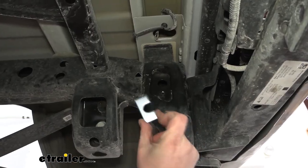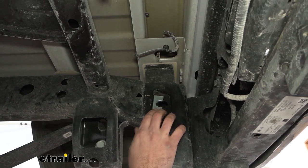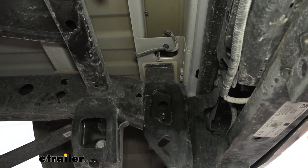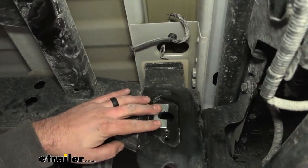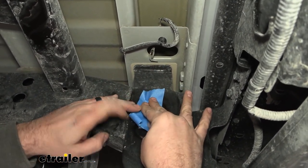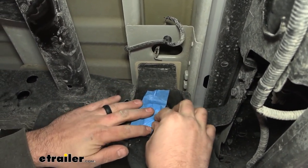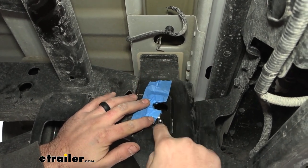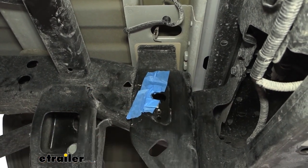On both sides of the vehicle, we're going to grab our U-shaped spacers, and these are going to fill up the gap that's in this inset. We'll need to make sure that we're not covering up the ground hole because eventually we're going to be using that new bolt to get the ground wire back in place. Center it up — you can see we still have our gap here — and then take some masking tape or painter's tape to keep this stuck in place, making sure it's notched out to be able to get that hardware in place. We still have our access hole here, so we're looking good. We'll go ahead and tape up the other side as well.